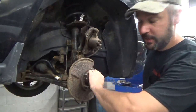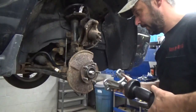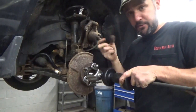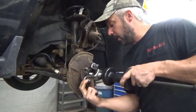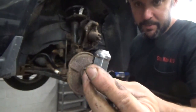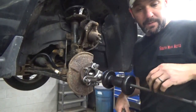The good thing is he's got a new CV axle, so that's not seized up. When using a slide hammer or puller, I always use old lug nuts or regular nuts with washers. If you use the ones that come with the car, when you smash on them it deforms the acorn and really pinches them down good. They get pretty well damaged.